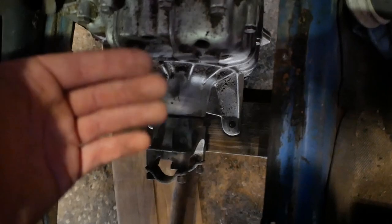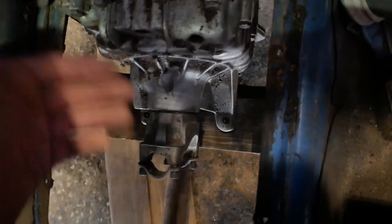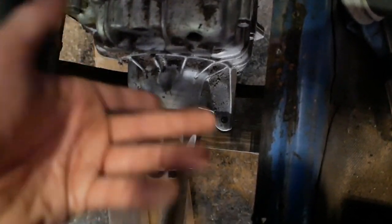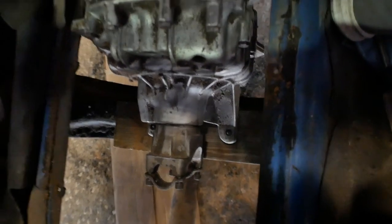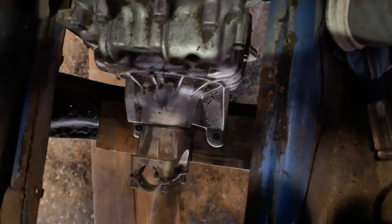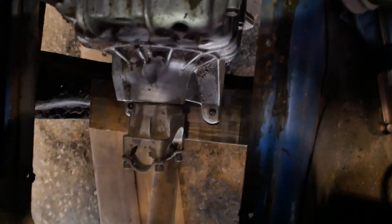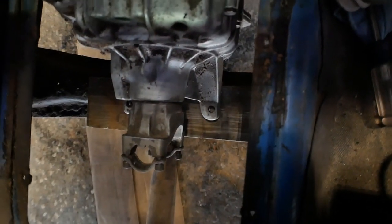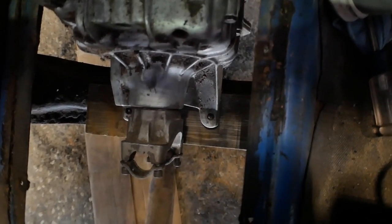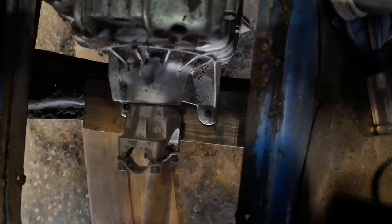And overall, the angle of it, even though we're using a two-piece drive shaft and that's not super important, the angles weren't great. The engine was only sitting back in the truck at about a degree. And what we want is like 3 degrees. So in order to do that, we're going to need to find a shorter transmission mount. We've got some options. We're doing some shopping. We'll figure something out there.